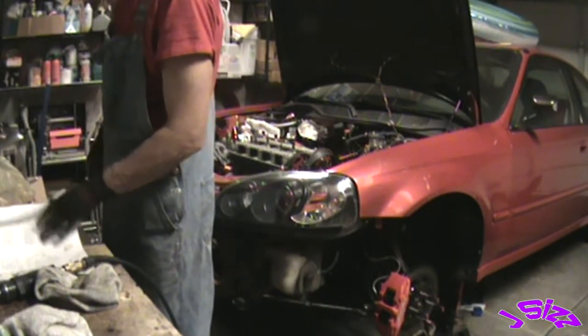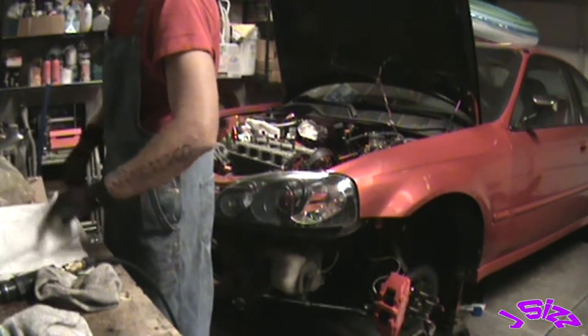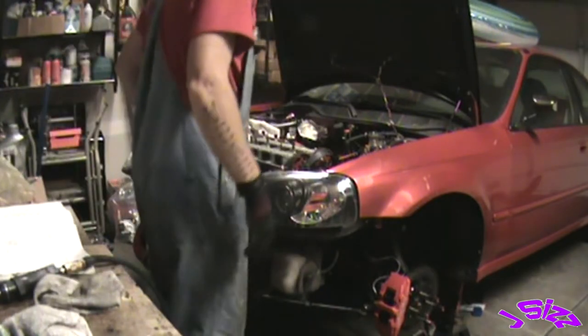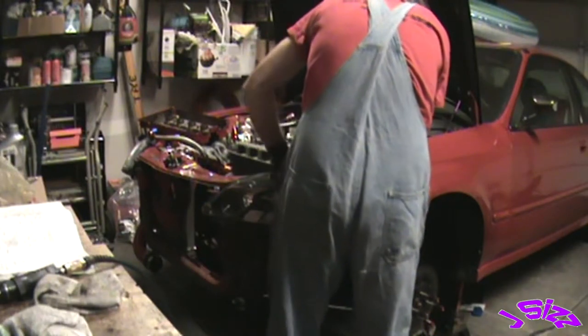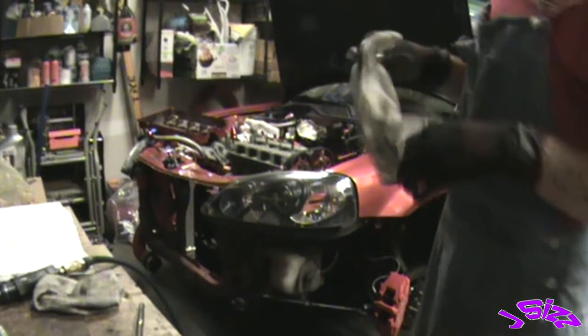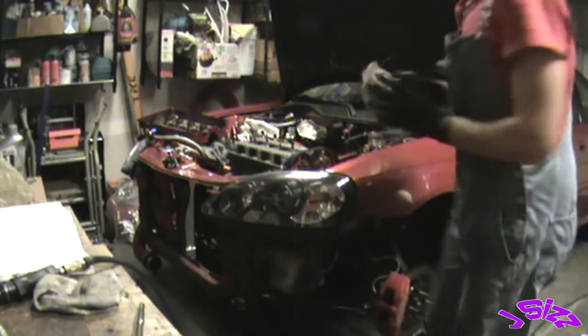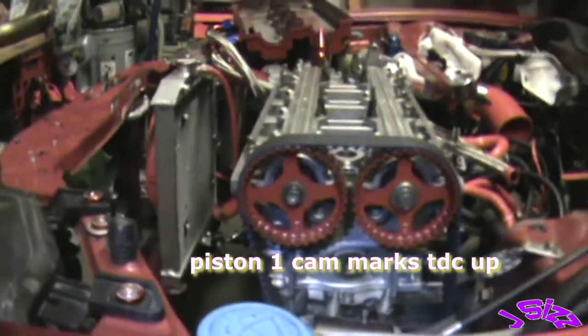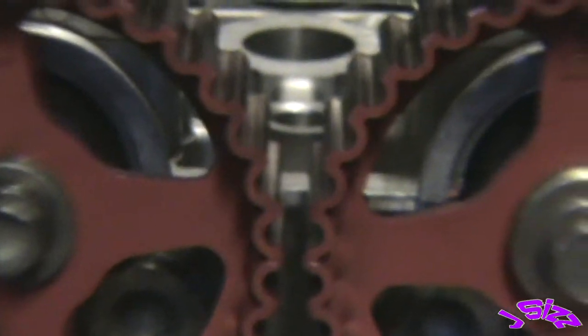They're talking about throwing the valve cover on already, huh? Let's get our timing set. This one always takes me a while to do because it's tricky as hell. I want to get everything perfect. I already got the crank at top dead center, and I got the cam gears close and snug. I think that was the quickest I ever got the timing belt on and set, like ever. Makes me so happy. All right, we're up. Lines going along the head.